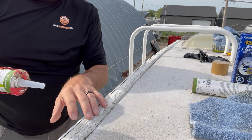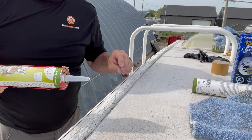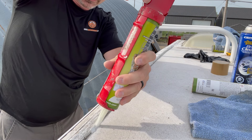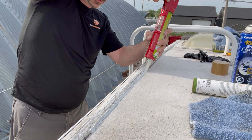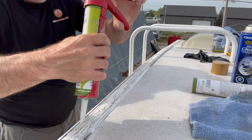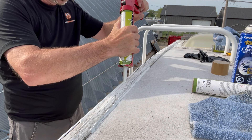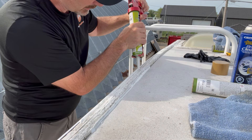It's going to look kind of messy at first because you're basically covering this whole area with caulking, then I'm going to put a rubber glove on and just lightly smooth it around, making sure I work it into any low spots and that it is kind of smooth. Then it'll self-level after that. The first thing I like to do is run it along the edge down in here first to make sure I've got a good seal right along the edge. You don't need a huge bead — usually just run it along there, sealing that outer edge first. Same thing on this side.